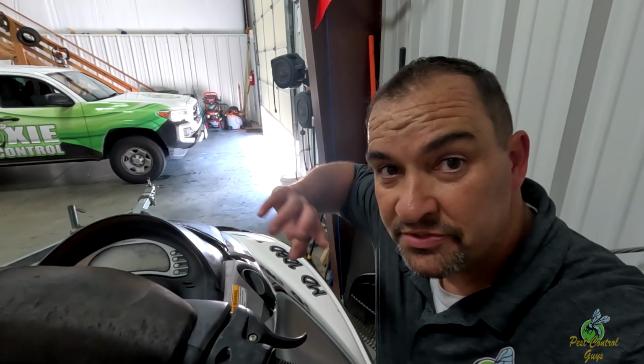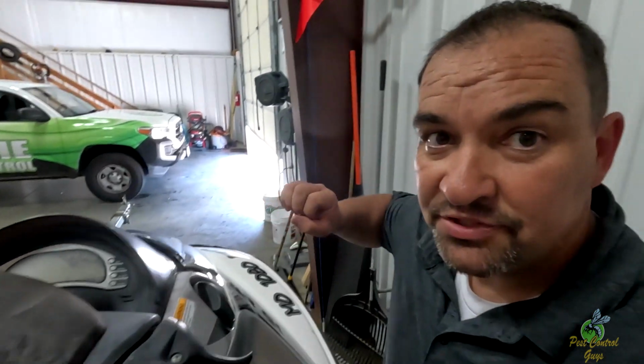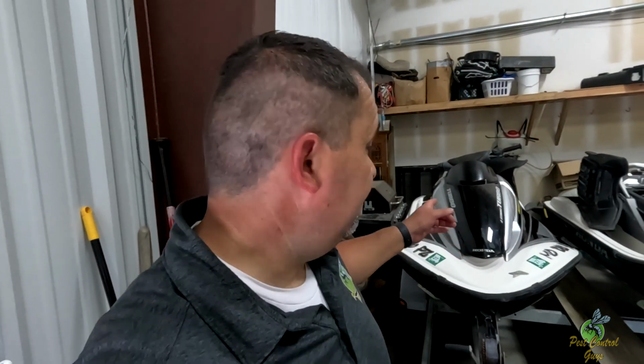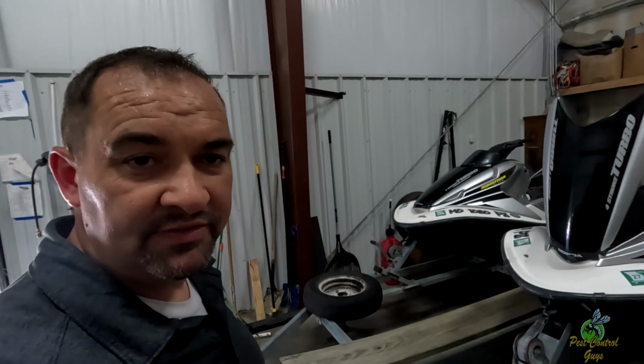And then what it'll do is it'll stop beeping. You can look at your warning light here and it'll flash. Long flashes are 10, short flashes are 1. On these, it was 2 long flashes and then 5 short flashes on both of them. So what I know now is we need to pull the ECUs out, ship them off, and get that deleted.